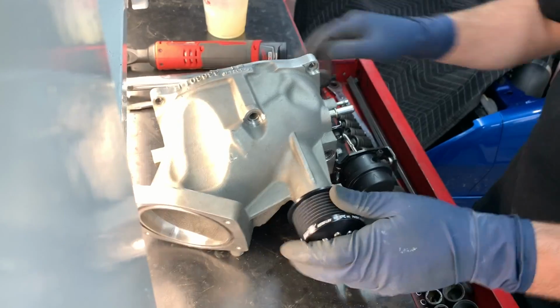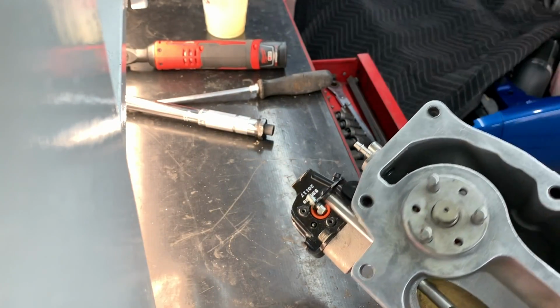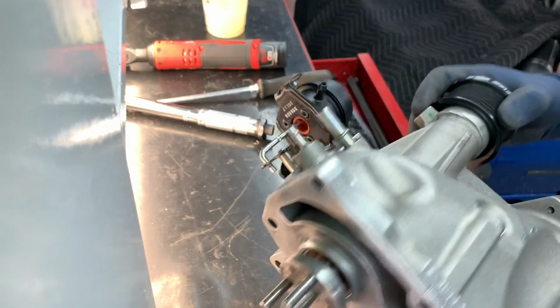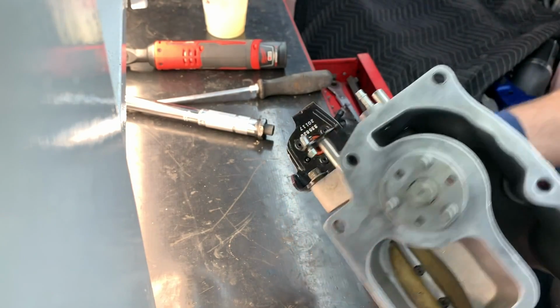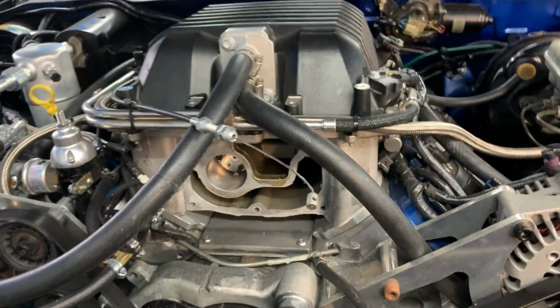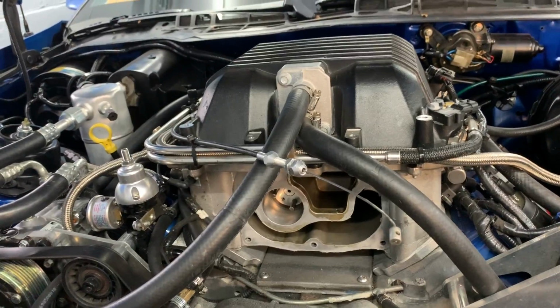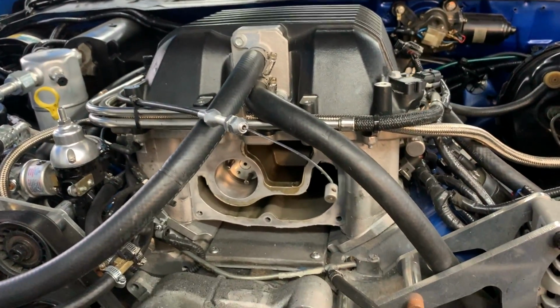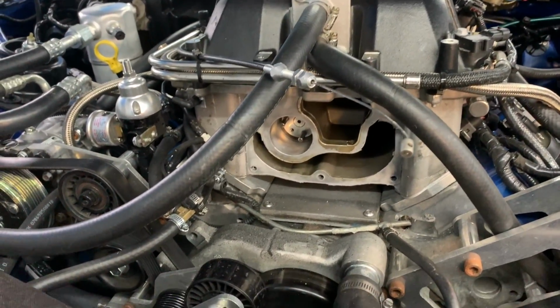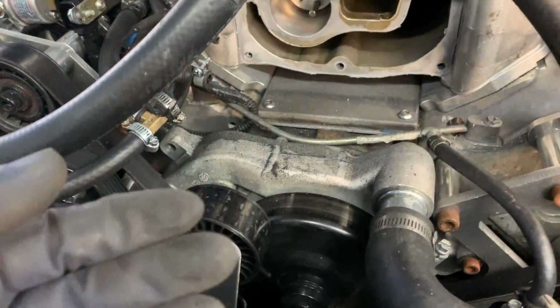So it worked though. Now I'm going to pop the coupler on. We'll throw some Ultra Gray RTV on this, get it back on the car, and then I guess we'll start pulling the bolts out and replacing them for the accessory drive with the stainless stuff. I forgot I still have to clean the blower off, so I'm just going to stuff some rags in there, come in with the same wire brush with the drill, get that all cleaned up. Maybe blow it out with some compressed air, get all these rubber pieces out of here.